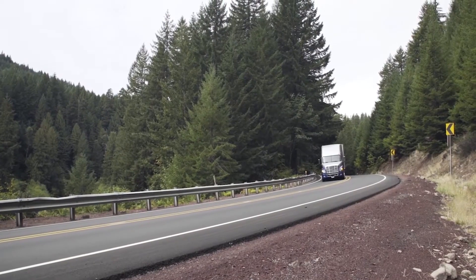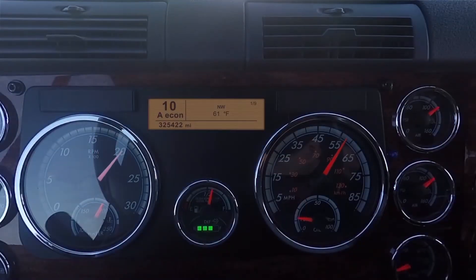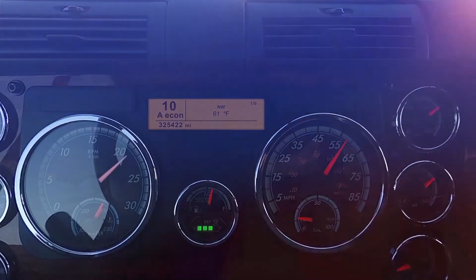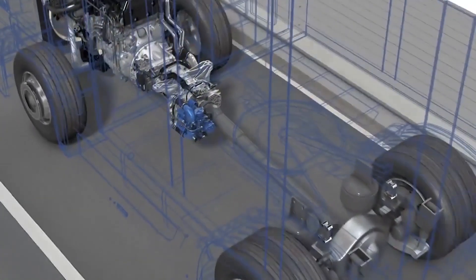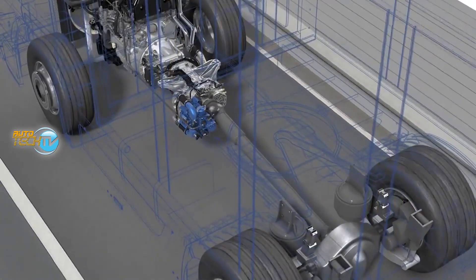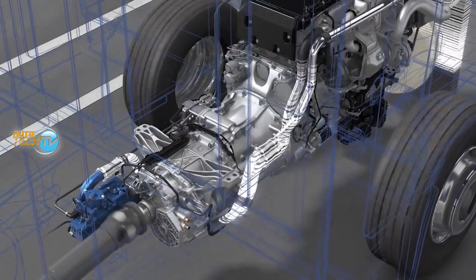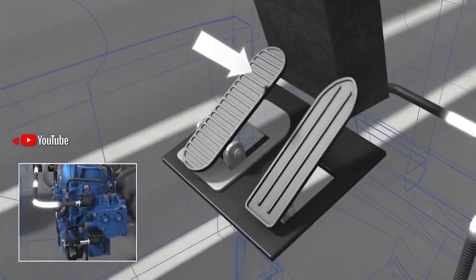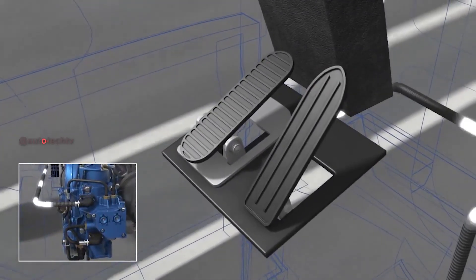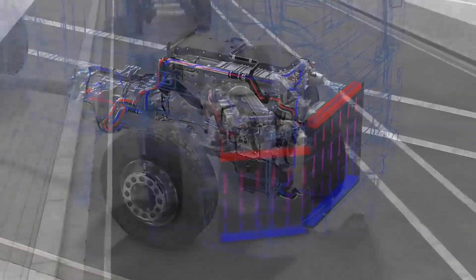So what makes the vehicle slow down? It slows down because the vehicle starts getting dragged, so to speak, from the transmission. Normally when you accelerate you are sending energy from the engine to the wheels and that pushes the vehicle. Well this process can also be inverted. When you are not accelerating at all, the wheels want to keep turning, but the engine keeps turning, consuming energy and wanting to slow itself. We call this engine braking.